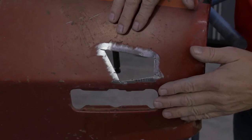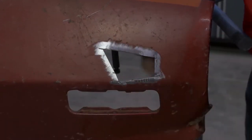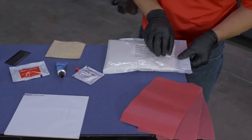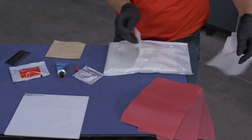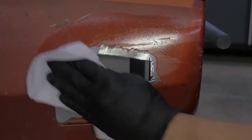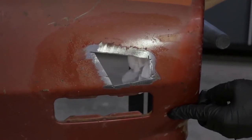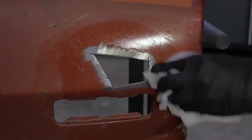Here's our repair — a 70s vintage wing with a small rust hole in the side. We've removed the rust with a saw and prepped around the outside to make sure we've got solid metal to repair to. The solvent wipes come in a convenient resealable package. Using the solvent wipe, we're going to clean both the front and the back side of our repair panel so that the tape used to adhere the mesh can definitely stick through the repair process.